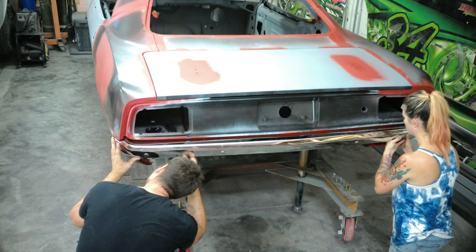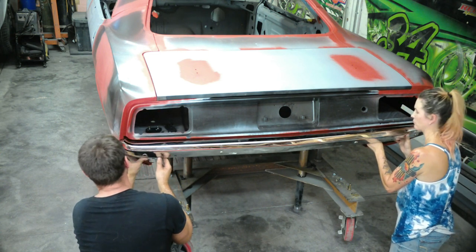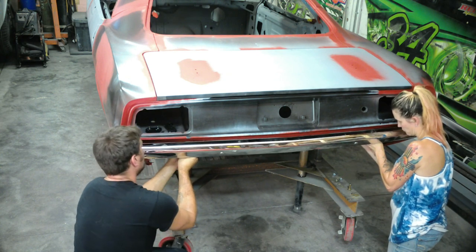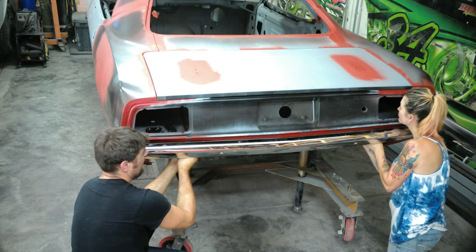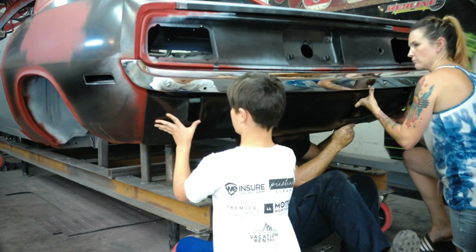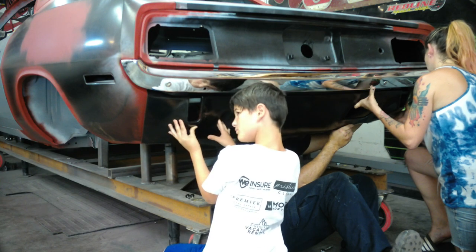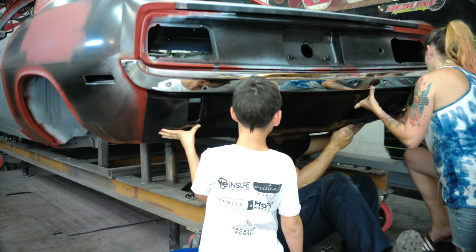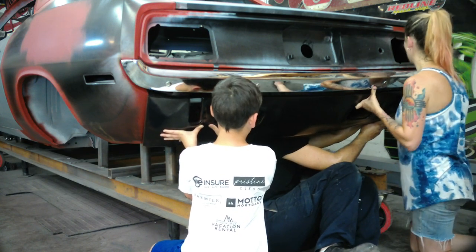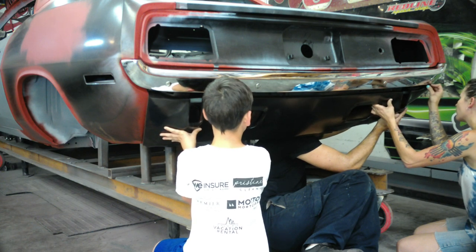While we're waiting on the paint in the trunk to dry, we'll go ahead and install the rear bumper. This bumper went on and needed a little bit of work — the driver's side sits too high and is too tight in the corner; we'll fix that in the future. Once the bumper gets on the car, we put the rear valance on — we got the one with the exhaust cutouts in it. This needed some slight modification because the quarter panel bottoms didn't really match up. I moved some of the brackets ever so slightly on the quarter panels and it came into place. I am missing the two center brackets for the valance, but at least we know the metal work is in place and it's going to fit on the car.